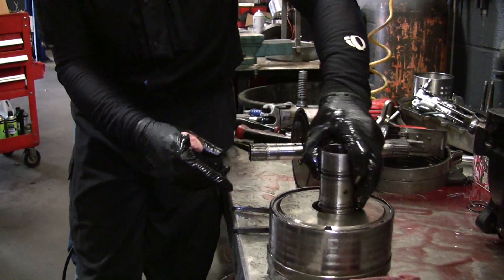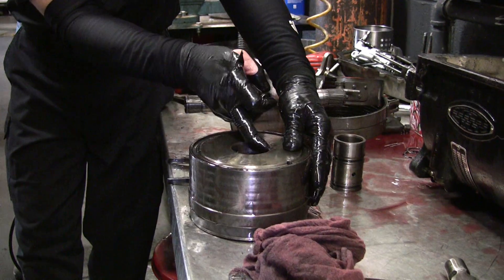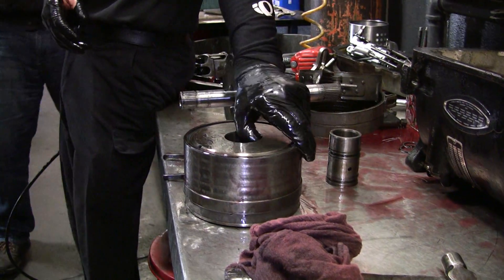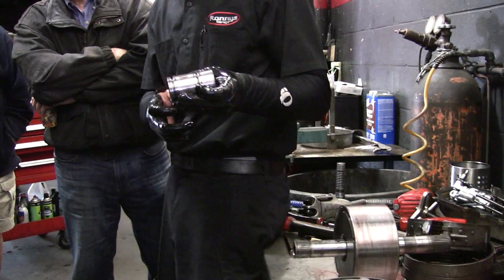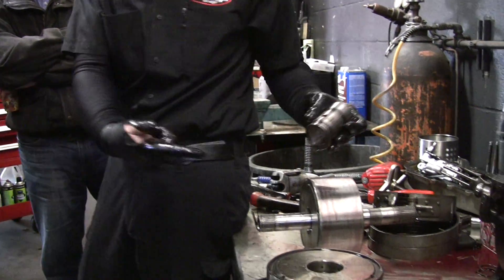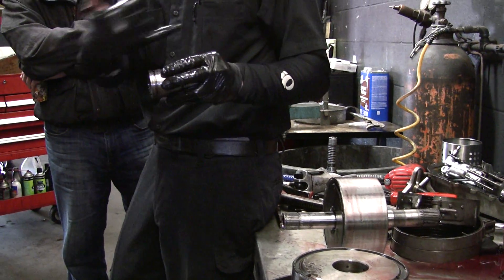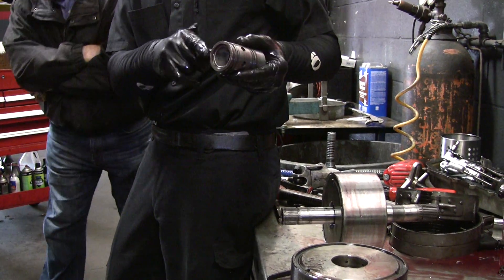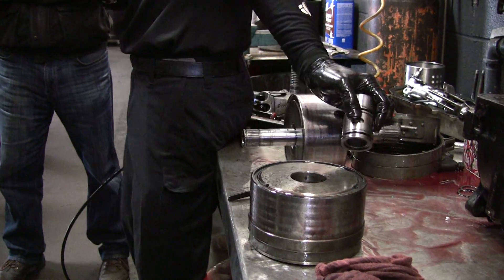These rings — this thing fits into there and this drum has little fluid pressure holes in it that are right between the rings. So when I was putting air pressure in there, it was feeding through here, through one of these passages, either forward or back, and between the rings and into these holes and applying the clutch.